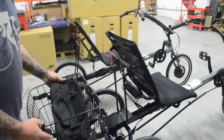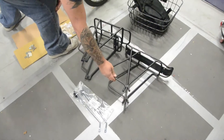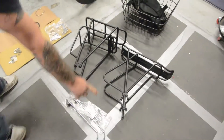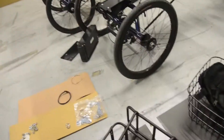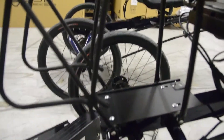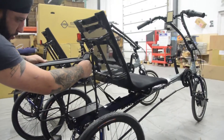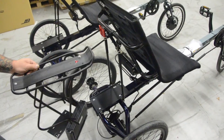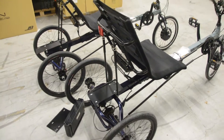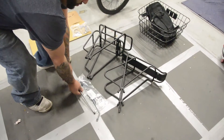One way to mount the battery is to use the rear recumbent basket from JMB. Another possibility is to use a regular rear rack — either our two-tiered rack or an Axiom Journey — with extra-long rack struts. These racks fit onto the rear seat ears of the bike, and you attach the extra-long rack struts down to the front seat ears. You end up with a regular rear bike rack sticking out of the back. It looks a little goofy, but it is one way to mount these batteries without using L-brackets and spacers.